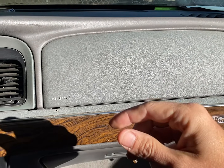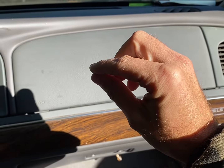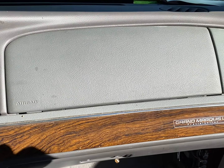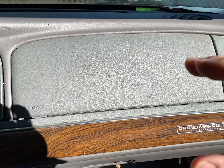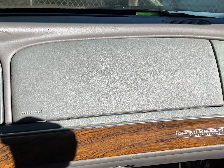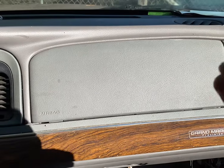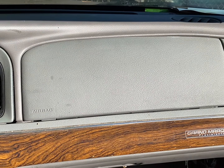It has an electrical plug in, so when you turn your car to heat, it'll manually push that and allow hot air to come in. But when it freezes up or it clicks or whatever the case, because it has little plastic gears that break and strip, you go in there, you manually flip it, maybe throw a little tape on it and unplug the connector, so whenever you switch it, it don't try to get stuck. Then throw your airbag back in, and that's it. 30 minutes.